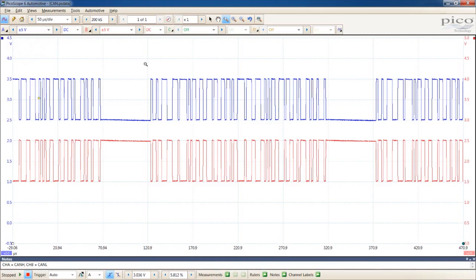These two traces - blue and red - are the two wires on the bike: CAN low and CAN high. CAN high is the blue trace. On the left-hand side scale, the blue CAN high signal goes from 2.5 to 3.5 volts - basically an on/off signal that changes between those two voltages. The CAN low signal, scaled on the right-hand side, goes from 1.5 to 2.5 volts.